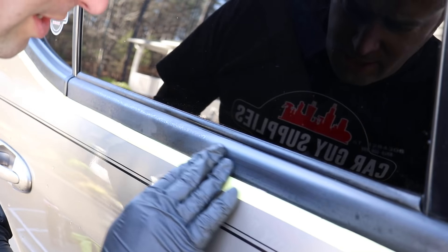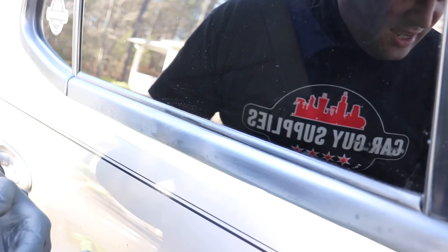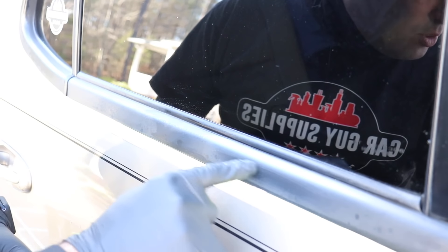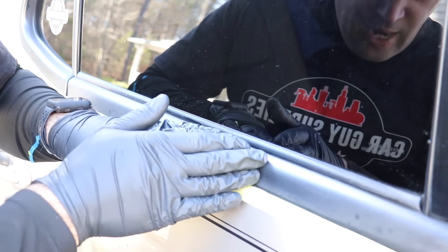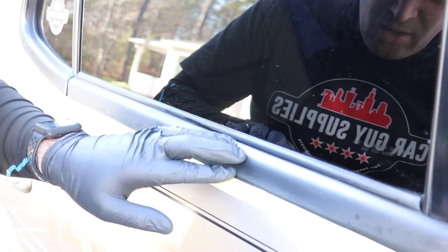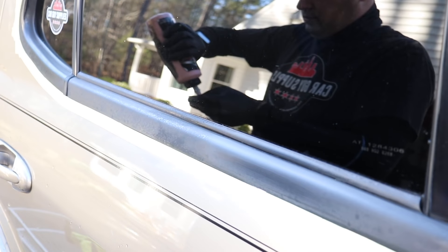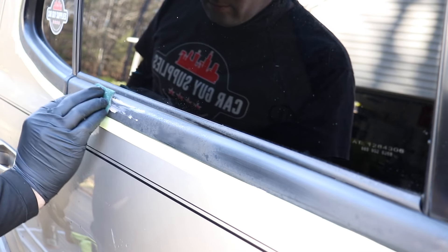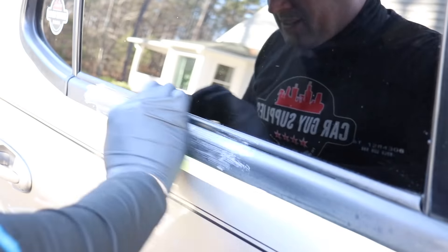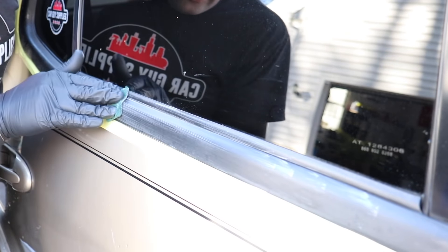Compared to the untreated area which is rough, textured, and oxidized, this is nice fresh rubber. It's basically like removing a layer of rubber on the surface and revealing fresh rubber underneath. I know some people are going to say you're ruining it, you're leaving lines in it - guys, it's an old vehicle, don't worry about that. If you're a detailer and you see this type of stuff, there's no other way to remove it that I've found. You have to abrade it and remove the top oxidized, moldy layer. Go in straight lines - with the grain of the rubber, which runs left to right.